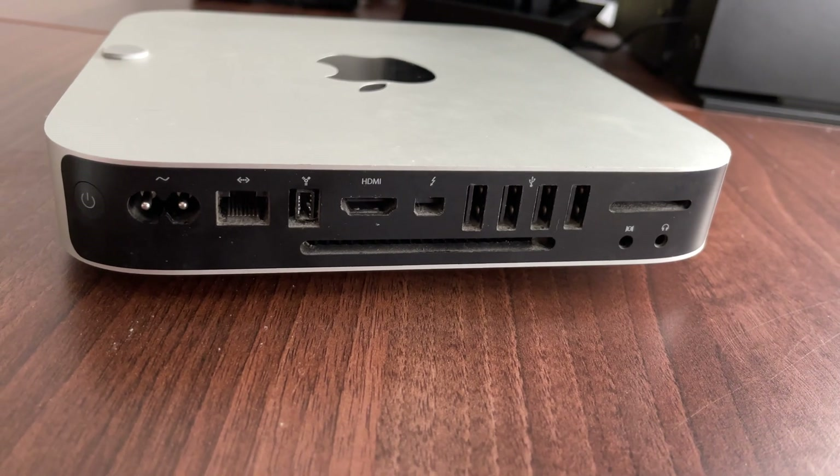Now I've got the fan back in place — that's a pretty simple process. Just put the three screws back in, just remember to plug the power connector back into the motherboard before you screw the fan down. And then I actually had a little bit of a problem with these two screws in that the screw holes on the SSD weren't quite lining up. So I've only been able to get one of the screws in — but it's plenty, it keeps the SSD in place. Again, I just wouldn't recommend it, so I ended up skipping one of the screws.